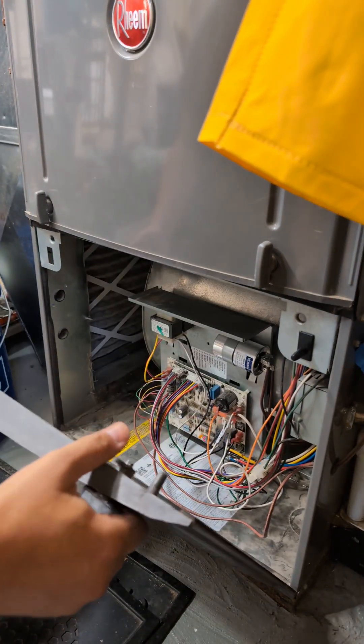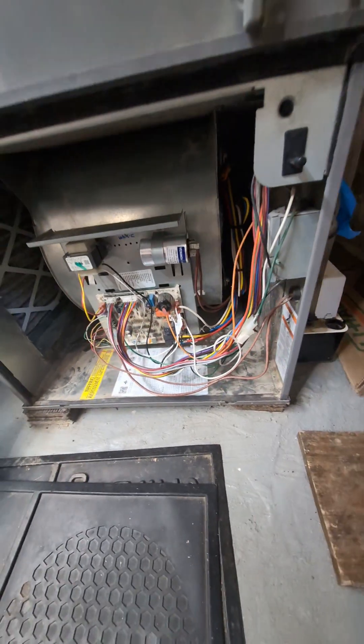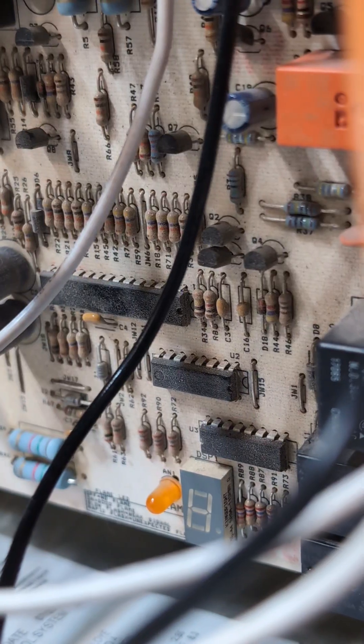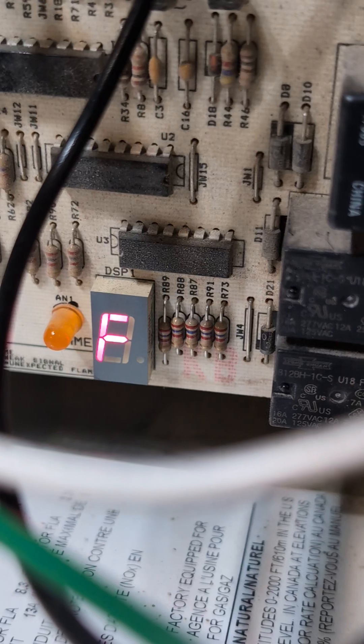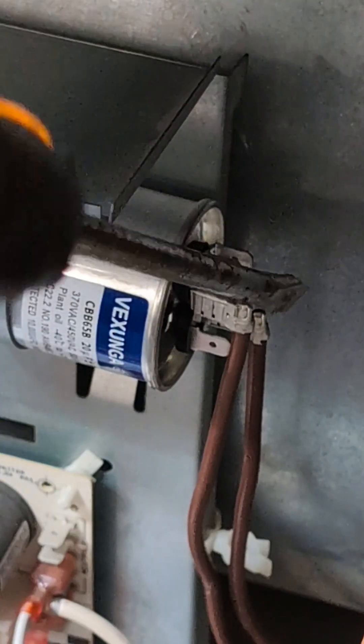Since I've been in and out of this thing many times now because I replaced the motor, I may as well look at the board and see if there's a cracked solder joint or something on the fan pin, because that was loose. Hopefully I can solder it back and fix it so the fan can just be used on all the time. Apparently that's less strain than the motor starting and stopping all the time, according to all the HVAC guys.